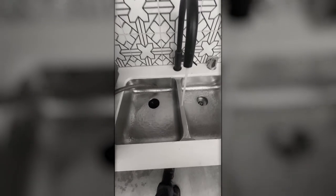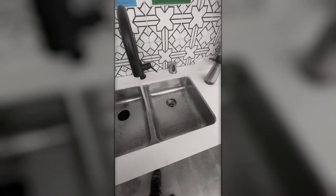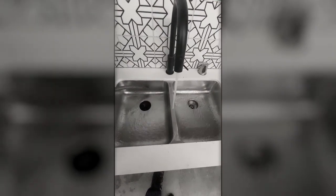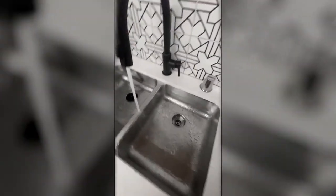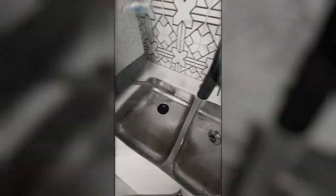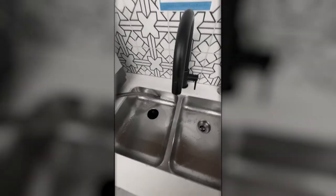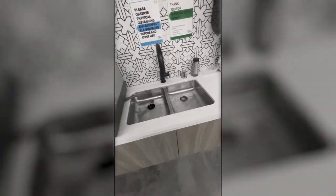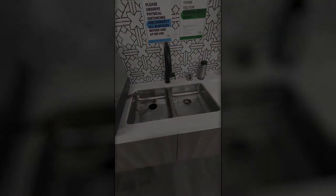If there's material in there, it might back up and you might get soap coming up into the sink. It won't overflow, but once you're at the stage where it's back to normal and you're not hearing the grinding, then turn off the switch and then turn off the water. Don't run the disposal switch without water running through here. But if you do that maybe once a week or so, you'll ensure that the grinds that go in there and whatever else people put in there will remain in a functional state.